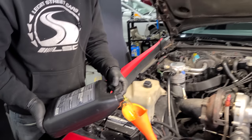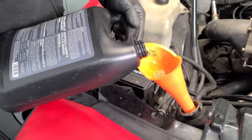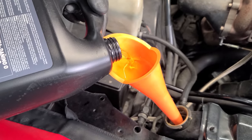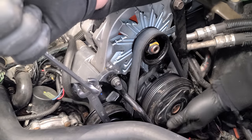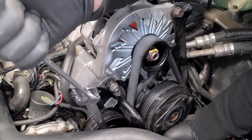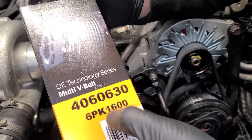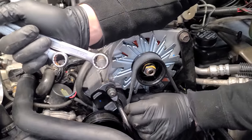Filling this up with antifreeze, then we have the intake system to install — all painted, plus our turbo cover. This engine bay is going to look so, so good. We removed a lot of garbage. Also, we went with a slightly shorter belt. When you ask for a belt for a Grand National at the auto parts store, they actually give you the wrong one. It's supposed to be a 630 instead of the 640 they gave us, per the guys at Aggressive. We were getting a little bit of squeak noise — that might have been it. The new belt is not too tight, it's perfect.